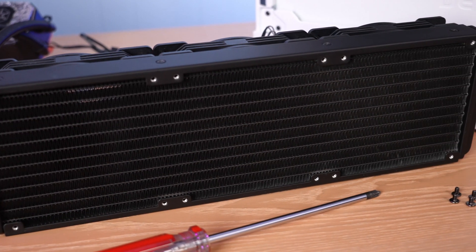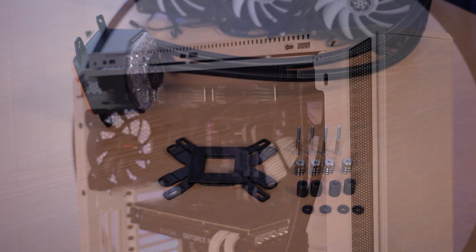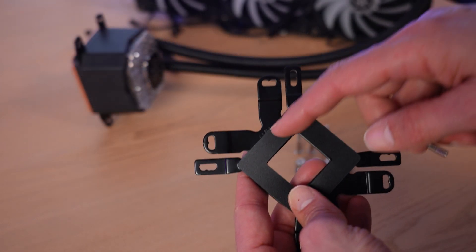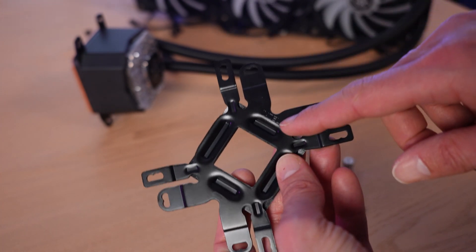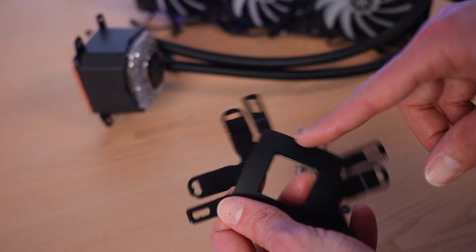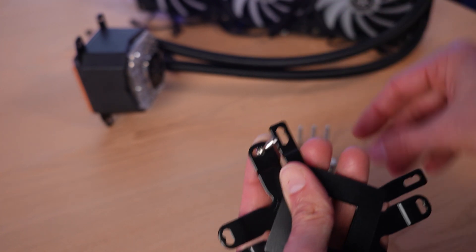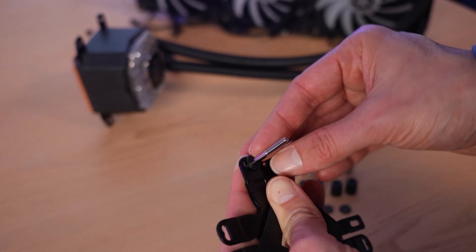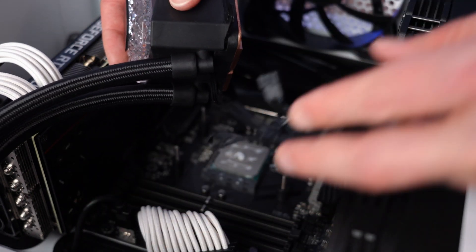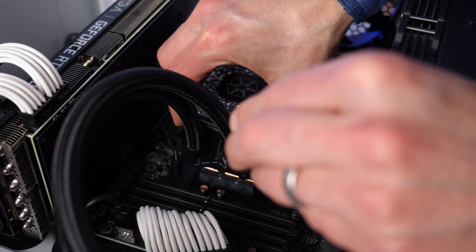Here's the radiator ready for installation in the chassis, and here I am installing it in the Be Quiet Silent Base 802. Here's the full mounting kit for AMD — it was a little disappointing because it has a lot of parts. This is not the standard mounting bracket you'd normally get, and confusingly, it says Intel on one side, although it is an AMD and Intel bracket. The main issue is that it's not designed as well as the standard AMD mounting bracket that comes with every AMD-based motherboard. These posts do not secure very well, and once you lower the pump into place, you may dislodge some of those screws, knocking them through the back of the motherboard back plate.